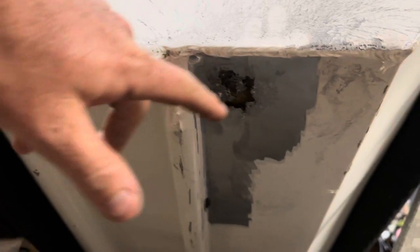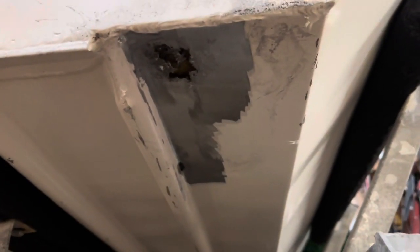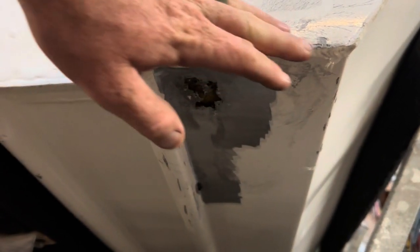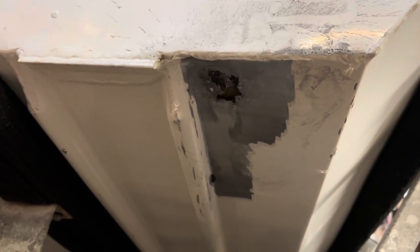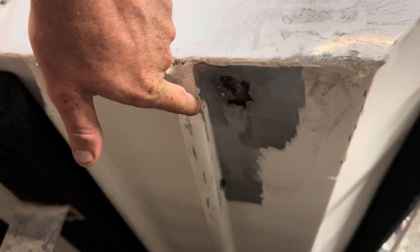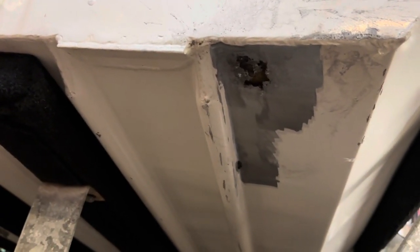I've already started to clean it a little bit down here. You can see that hole is completely rotten, and there's another hole right there that's also rotten. It looks like there's some rot starting right along through here too — not sure if that's from the acid or just corrosion. Either way, we're probably going to touch up all those spots. We're going to end up cutting out a plate and plating this whole thing all the way to this rib right here — actually, we'll probably go just past the rib so we can get some decent material to weld to.